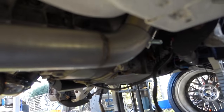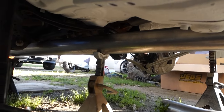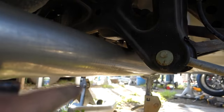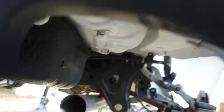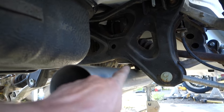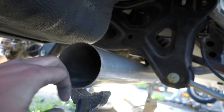For now this is going to work. This is tucked up pretty good — I don't think I'm gonna have too much clearance issues, especially considering how big the exhaust is. That jack stand is just there to keep the weight off the headers. It's going straight back, and right back here it's hitting. I'll probably cut that right there and put a 45 or something like that to get the exhaust over here and have a dual exit right there. Even if I have to, I'll cut that brace right there and just flatten it out to give it enough room. Got a little dirt in the exhaust — I'm sure that would have flew out.